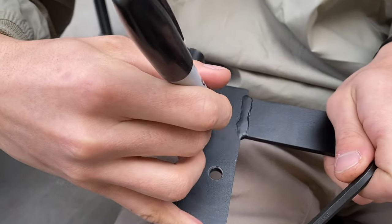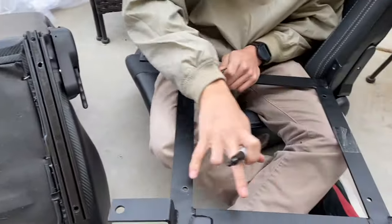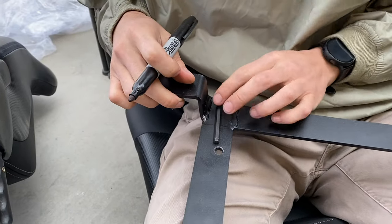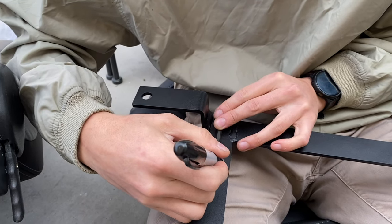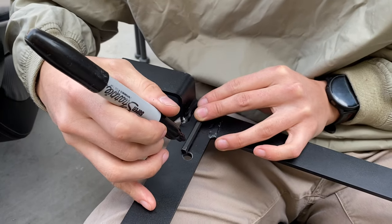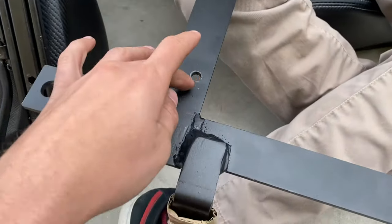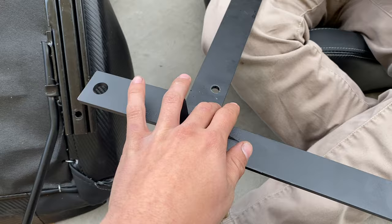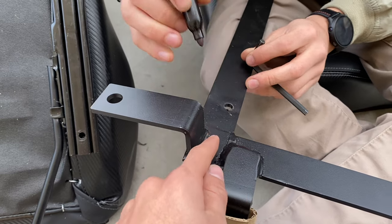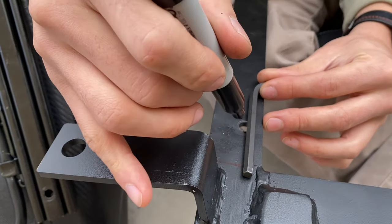The length of this bracket is the same regardless of the two bolt holes, so once I drew the line I know where the drill hole is going to be — I can match it parallel to the old bolt hole, which makes it wider. We're using the last original hole as a reference to determine the new hole position, which helped because we knew the exact distance. The key is to be parallel.